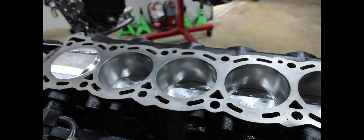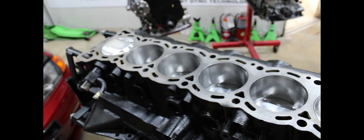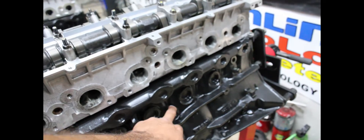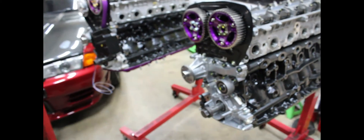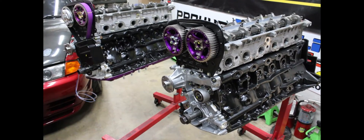We've lost a couple of them in the 1,000 horsepower range to those cracks. After we started doing this, it's been over four years of running this setup without any cracks, so obviously it works very, very well. If you have a 24U block like these, we still do it. With those it's very difficult to get them to crack because the casting is a little bit different. But this approach to building the engines turns pretty much every engine into a 1,000 horsepower ready block.